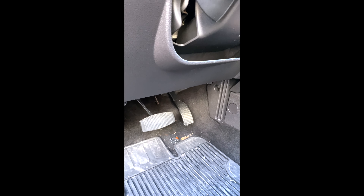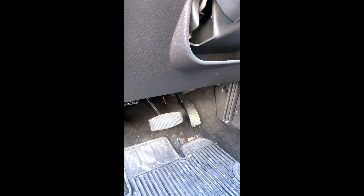So I followed that wire and it goes up underneath the carpet and comes up here to the transmission shifter cable, and that's where it goes — to that grommet to the outside. Now I'll go ahead and disconnect it from up here, repair the wire, put some heat shrink on it, solder it, and then start pulling that wire out.